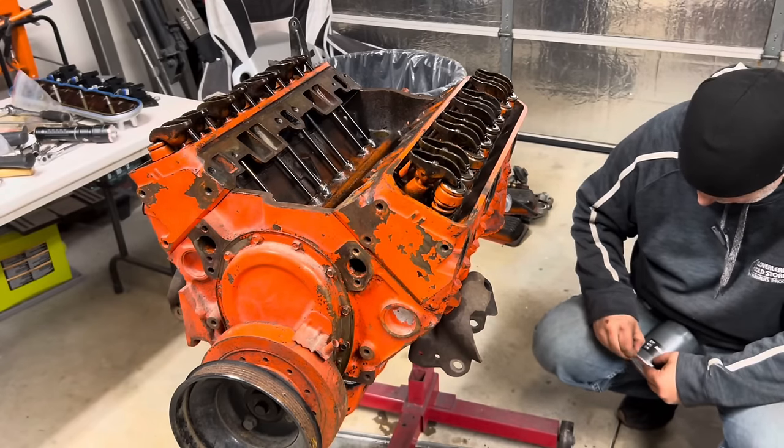Hello. We got good oil pressure. Go back in there. Go back in. Well, the oil pump's good, primed, and I did see some oil spurting out of the push rods. That's a good start. And we get an intake on it, and an oil pressure thingy, and we'll go from there.